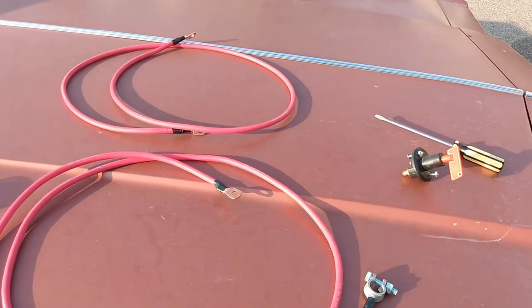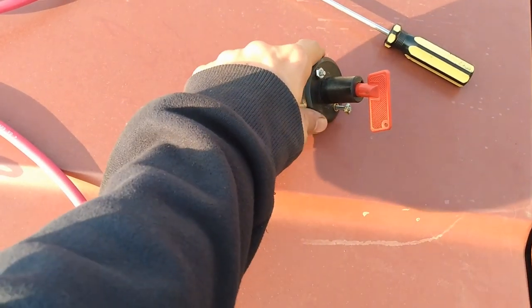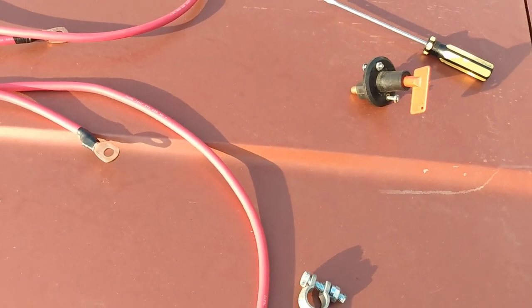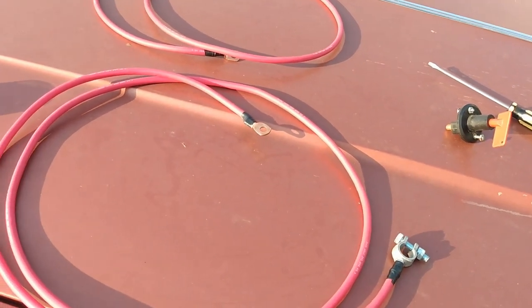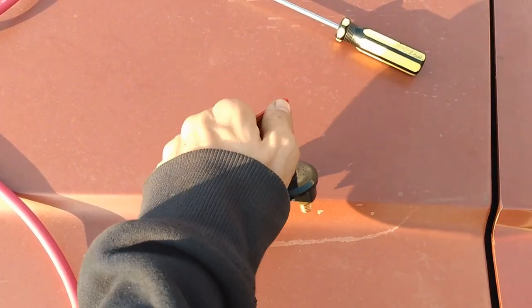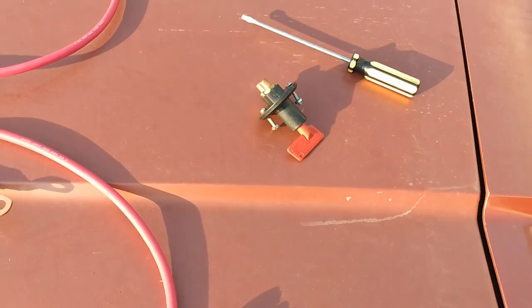Now I'm going to rig up a battery cutoff switch, both as an anti-fire and anti-theft deterrent. Just can't trust a car that sat for 22 years on its own and walk away connected to the battery. I don't know how crispy those wires are, didn't shake every strand. This is just for peace of mind until I can drive it long enough to know what it's doing. Just, you know, unhook it when you walk away. Take it with you. Pretty foolproof.